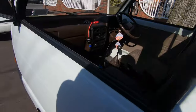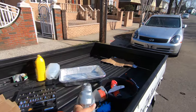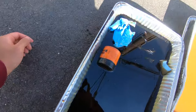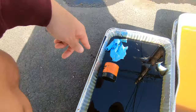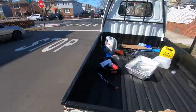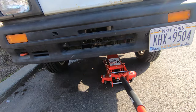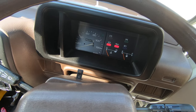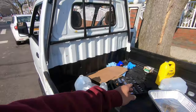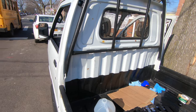Battery cover is back on, fits perfectly. Shout out to USPS for giving us some cardboard. Oil has been changed - three quarts of oil. Coolant flushed. We're going to recycle this the right way. The Fram P4967 fits the Hijet and the Mobil 1 M1-103A filter works too - go back in the video to see the exact numbers. Coolant was really dirty but thankfully we changed it. Let's drop this down, start her up. The truck is sounding much better - it's a fan of this warm weather and the new oil. We changed the battery, changed the oil, changed the coolant - the K-truck is ready to go, maybe for sale very soon. If you're interested, maybe hit me up.